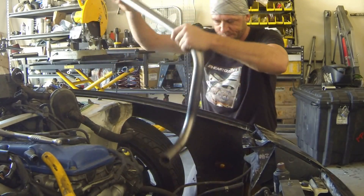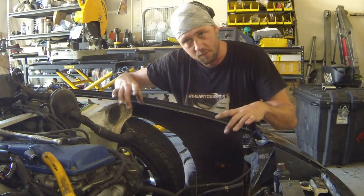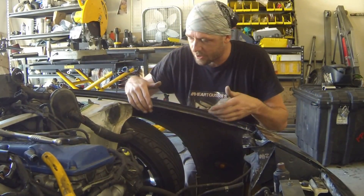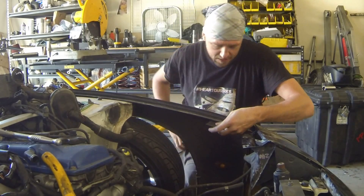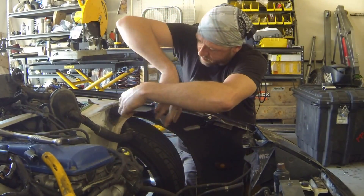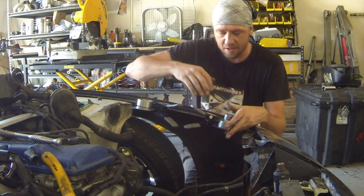One thing I want to add up top here is a place to mount the fender tube. I'm going to spice it up, make it look nice, keep the weight reduction low and the strength up — I'm going to run gusset plating with dimple dies in them. The gusset is going to start at the top of the tube and run underneath the fender to another tube in the framework. To get the spacing correct with the dimple dies and make sure the height is set correctly, I'm just going to clamp in a couple pieces of sheet metal — it's a little primitive but it does the job. Then I'll take my dimple die, line it up, and set it against the fender to make sure I have more than enough space.